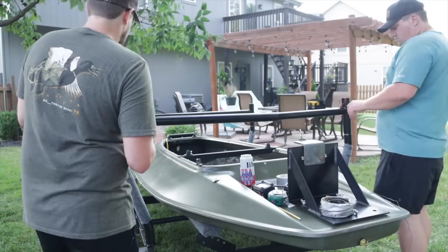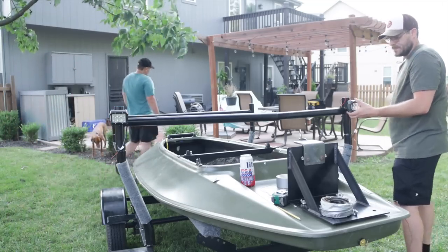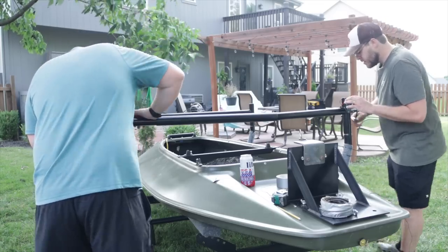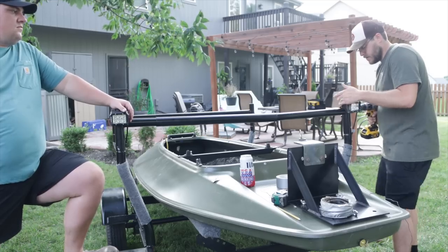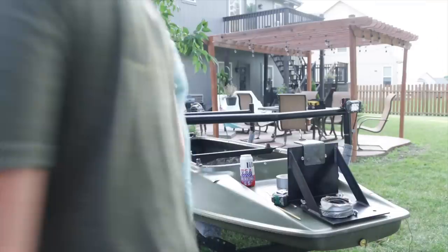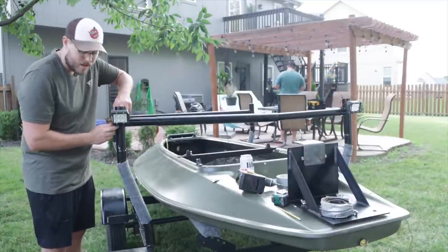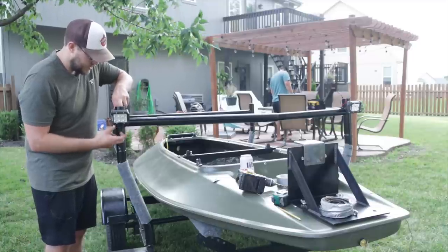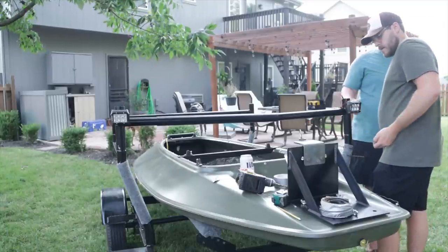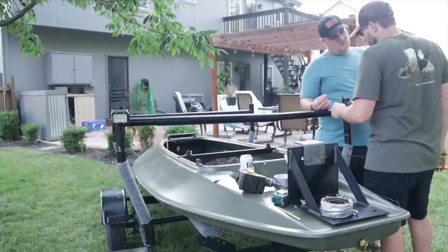It's not the tightest thing in the world but I think it might work. Maybe just hold on to it while I tighten it down — it's like a toy gun. My fingers are all greasy from that sausage, I've got sausage fingers. In case you guys aren't keeping up, I had more black wire than red wire, so the positive running from the trailer to the lights is black connecting to red and red connecting to black.